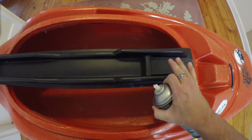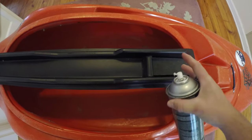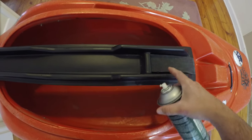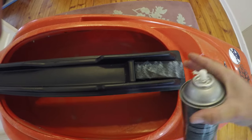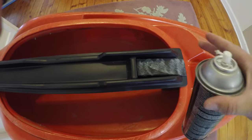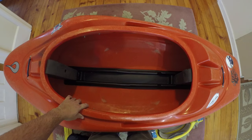The original center track had more thickness than this newer style one, so you can play with it — leave it in or take it out. I told Eric I was going all in, so in order to make this work so that the pillars are still tight, I shimmed in a piece of foam and glued it down to the track. Then I'm going to spray glue to give it both a little lubrication to slide under that pillar and glue into that pillar like a sandwich. Once it's installed, all set.